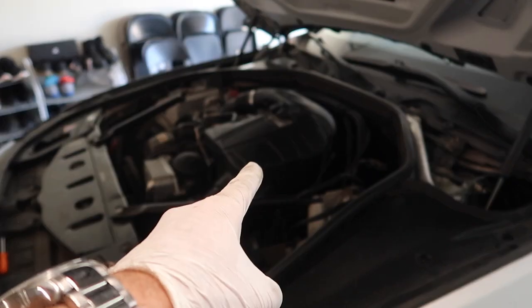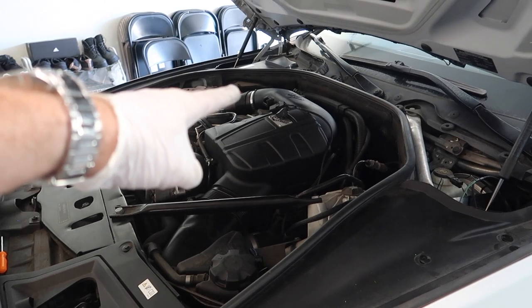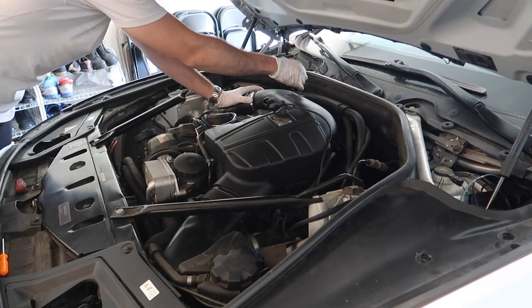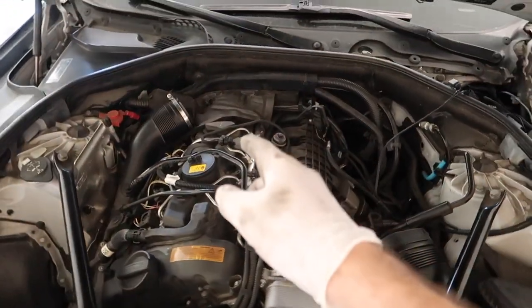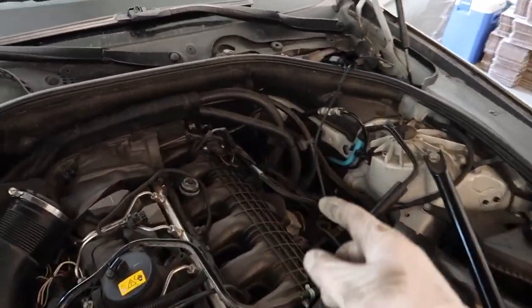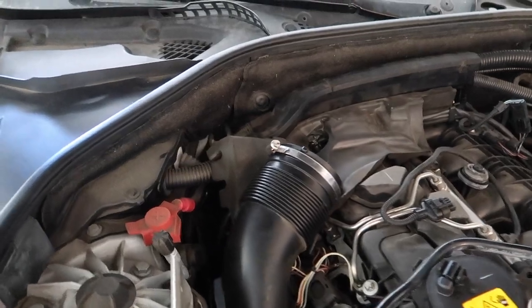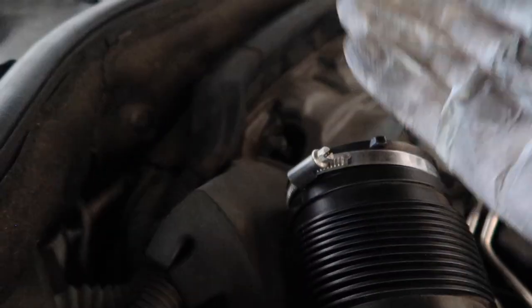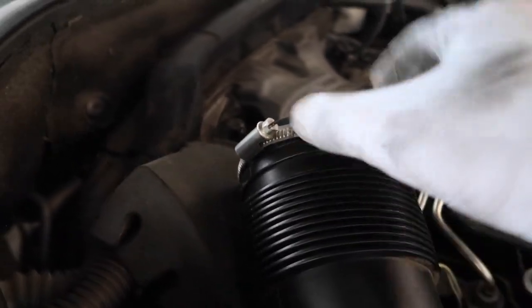Next, we need to connect the fuel pressure sensor. To do that we have to remove the intake — it's very easy, just one screw up top, then unplug the sensor and the whole thing comes out. Also, just a reminder: you don't need to plug in the fuel sensor if you don't plan on running E85. I'm going to plug it in for the sake of the video. I'm not sure yet if I'll run E85, but it doesn't hurt to have it hooked up so I can check all my settings through the JB4.